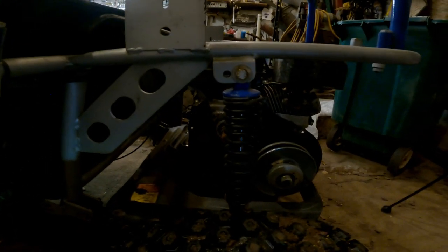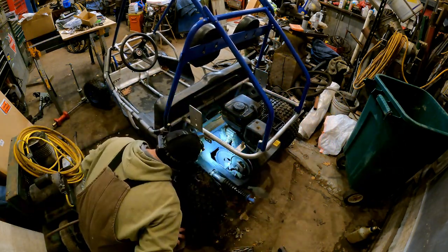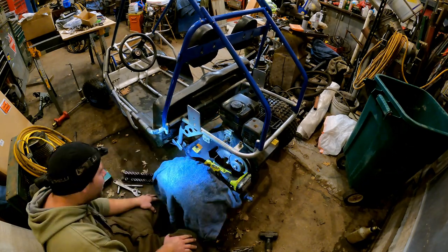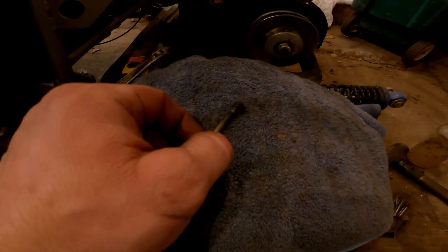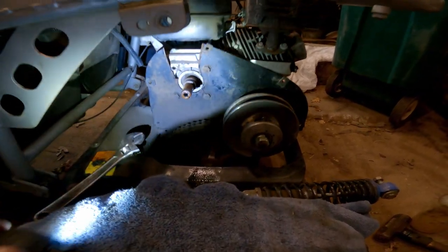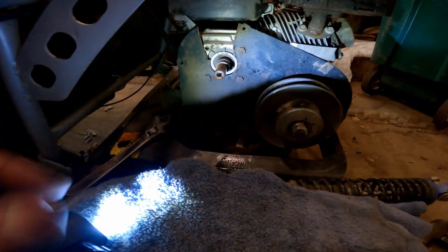I was hoping it was left-handed thread because they broke that out of the engine, which means not good when you see these — we're having a bad day, really bad day. They snapped that bolt off, which is never good. We're going with the old twist and pray. Easy-out worked for me — it never does though. I'm going to move this shock out of the way, then drill her out, put the easy-out in there, probably add some heat. Cross my fingers hope it works, and when it doesn't we'll just drill the whole thing out, tap it with a different thread size, and move on. Well, I could have won the lottery today — I never get this lucky.